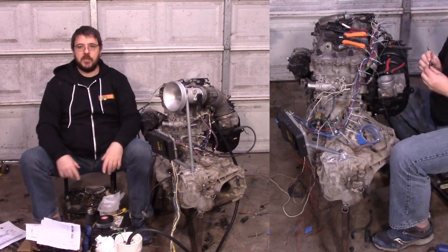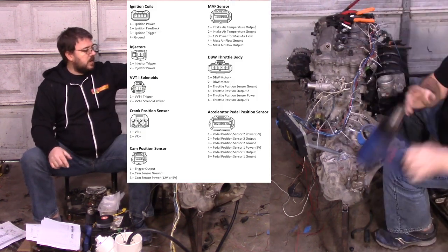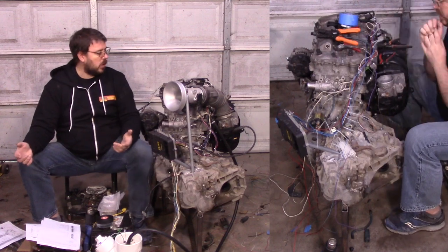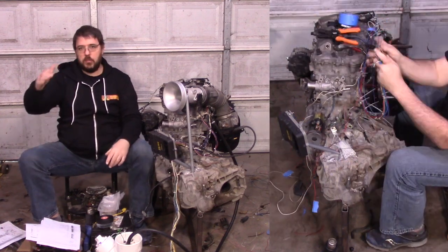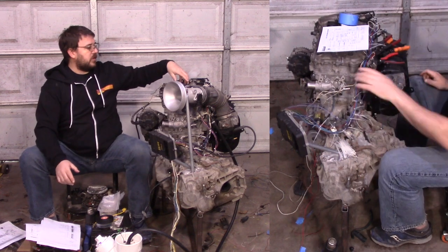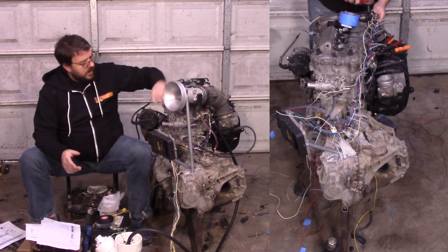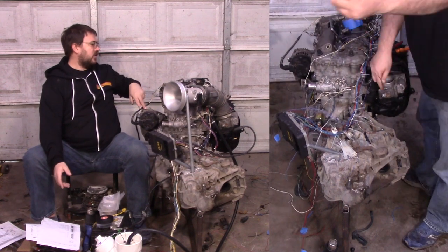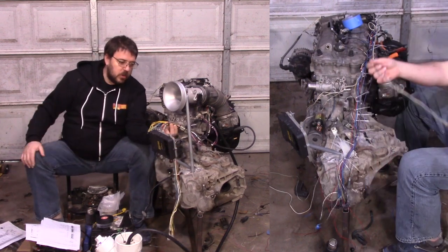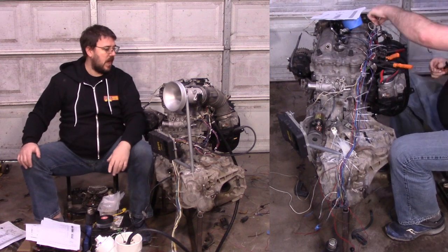Between that report and a cheat sheet — linked in the description — for all the multi-pin connectors showing what each wire does, I can make sure I put everything in the right place. Other than that, I'm not actually working from a wiring diagram; this is all just one point to one point. I work in order of function: first all the ignition coils, then the injectors, then coolant temperature sensor, charging system, cams, crank. Just take one subsystem at a time, and the next thing you know you've got this giant bundle that looks scary at first but really isn't that big of a deal.